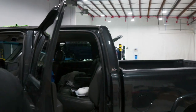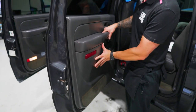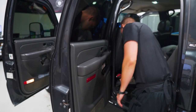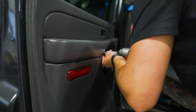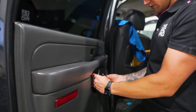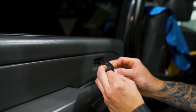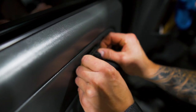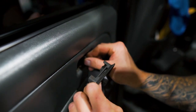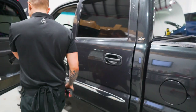We've got the doors done. Turn the key off so the battery doesn't die and put these gaskets back in quick, then slap the back window on. To put the gaskets back in: pop it back on, push the panel against the door, lift it up, push it down, lock in place, put the screws back in — one behind the handle, sometimes you've got to shift the panel a little to get that hole aligned. One on the bottom corner, door lever cover back, then the lock switch: put this forward, front end first, make sure that hole lines up into place.